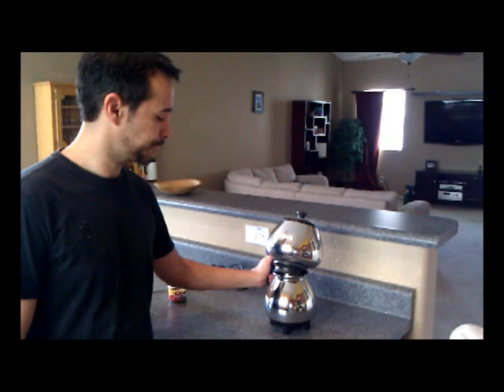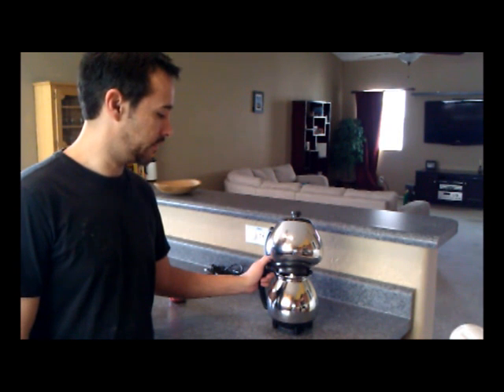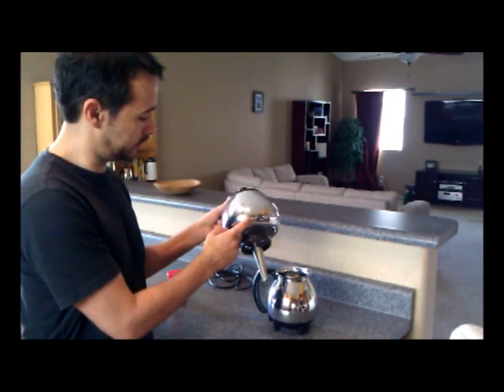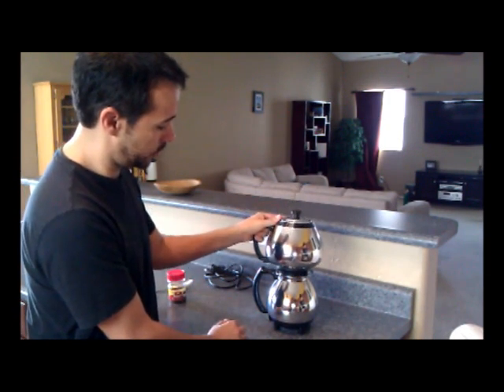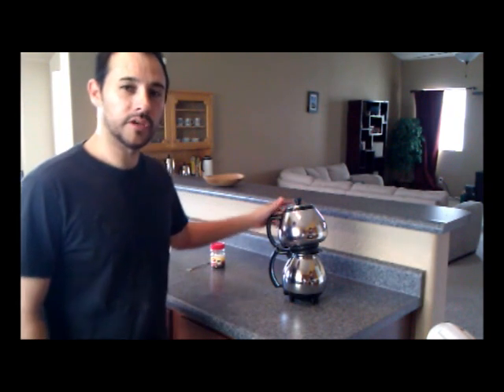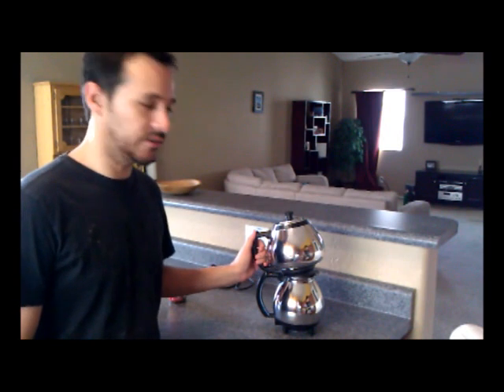This is a vacuum type coffee maker, first made its debut in the late 1940s, and is still considered today to make one of the best cups of coffee. The inherent problem is, over time, this gasket — which separates the upper part, the reaction chamber, with the server — hardens. If the product is together, you will not be able to pull them apart. If it's separated, you will not be able to get them together. These coffee makers are considered quite collectible. So today, hopefully, I'd like to demonstrate that the CA30 coffee maker from the 40s does in fact work, and that we can put together the upper and lower halves and pull them apart with some degree of ease, and then enjoy a delicious cup of coffee.